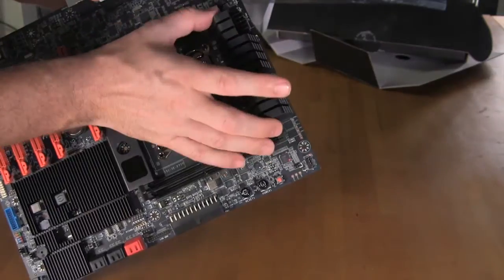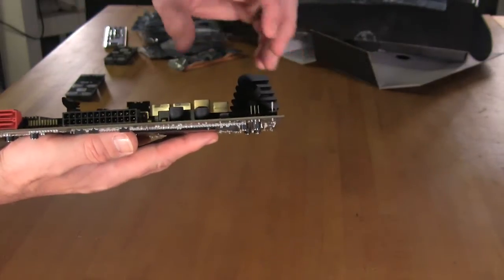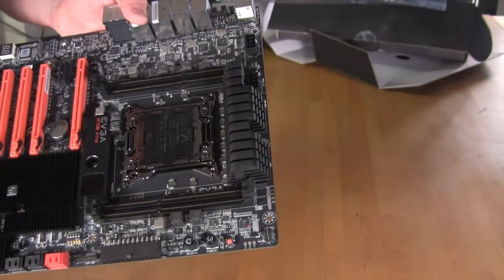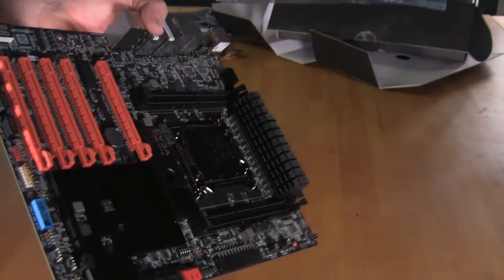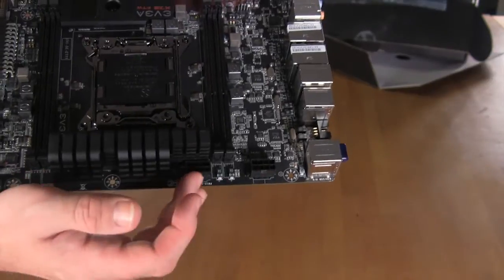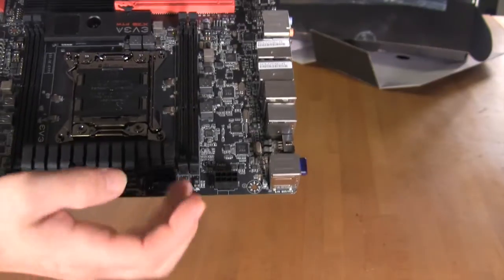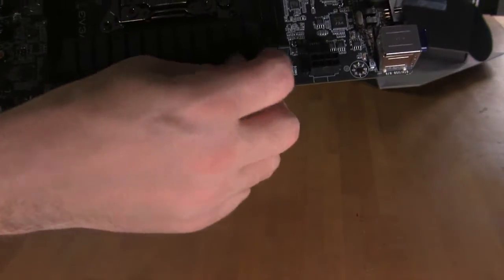Taking a look at the heat sink, this is a pretty beefy heat sink with some nice fins. These are pretty extensive, but it's going to only be as effective as the amount of airflow you can get across it. You do have a lot of thickness here to pull heat off of your power regulators, but it's still going to need a lot of airflow to maintain its cooling, especially if you're going to push this board quite a bit. You'll also notice that EVGA gave you two 8-pin ATX auxiliary connectors, which is going to provide more power to the memory and CPU. The primary one is a little difficult to get to — it's right up against the heat sink — so we recommend that you get those extension cables; it's just going to make things easier.